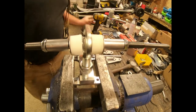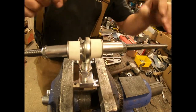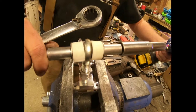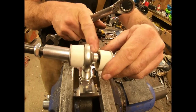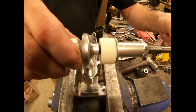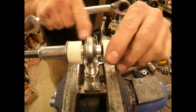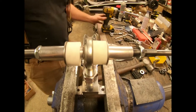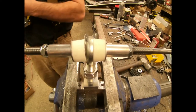At this point it's a good idea to pull these back and check inside. If you pull the bushings back there are two axle nuts that hold the axle on center — make sure there's no play in those and that they're tight. We red loctite these in, and once they're loctited in there they're good to go. We'll go ahead and adjust the preload on these.